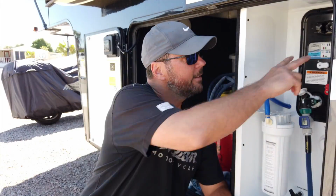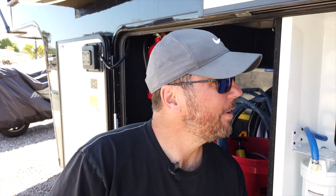Another quick tip, this guy right here, if you're out here and you use those, be sure to close them. Even if you have the hose disconnected, if those valves are open, you will have a situation where your water will not be hot. You'll get this lukewarm water and you'll be like, what's going on? My water heater's broken. It's not. There's a bleed over there, and the way the water routes, it does something to the hot water where it sends the hot water off somewhere else. I don't know what it does with it, but that's happened to us before. Yeah. We've had several times where we're like, what's going on? And by the third or fourth time, it's like, okay, yeah.